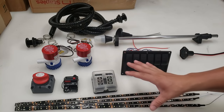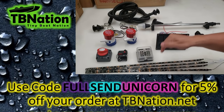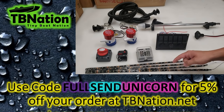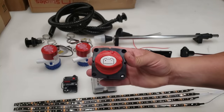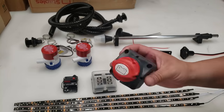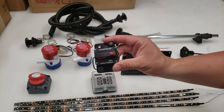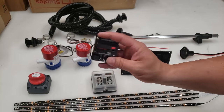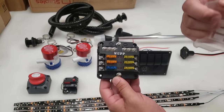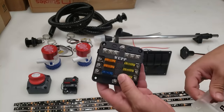Let's run through everything I'm going to be using to build this electrical system for this boat. All of the links to the products I'm using are down in the description box below — you can get them through tinyboatnation.net and use a promo code for 5% off. Starting off with our battery disconnect — this is just a basic one-off, one-on battery disconnect. I'm going to be running two batteries on this boat, but hooked together for my 12-volt system, so we only need one battery disconnect. Next up is the fuse for the trolling motor — this is a 60 amp with a little push button reset. Then we've got our power distribution block that is also a fuse panel with six circuits.